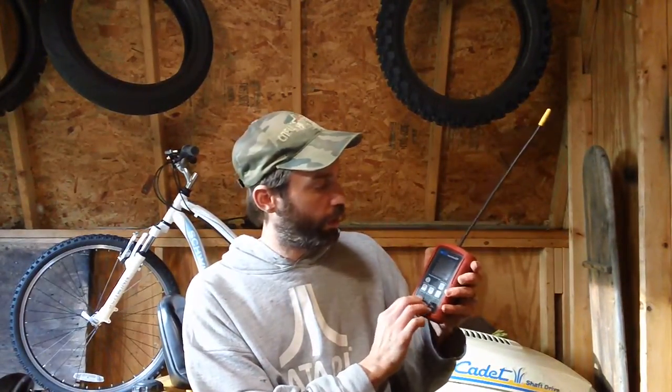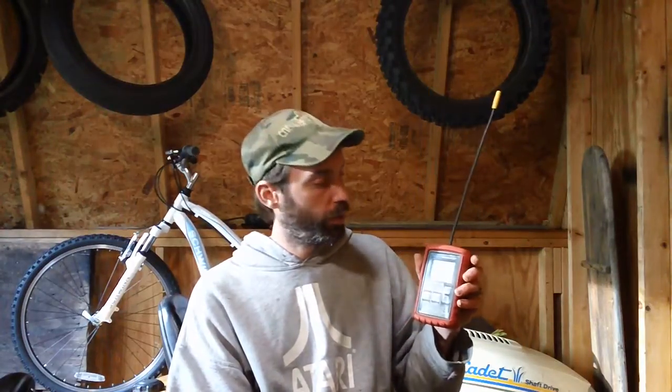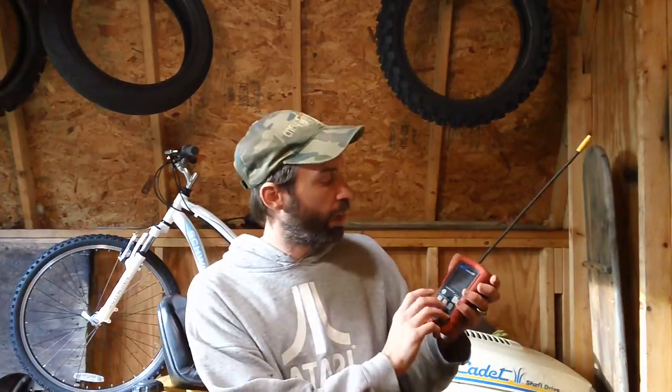And the last thing I got here for electrical systems is my Smart Tack COP tester. It's a TS 5000. Basically, this thing has a pad on here, and you can check your ignition systems with it. This tip right here goes near your spark plug wire, maybe about a quarter of an inch from it. You don't put it on a spark plug itself. You put it on a spark plug wire near the cylinder head, and you program it on here.